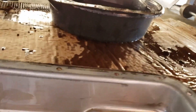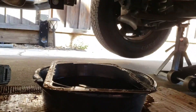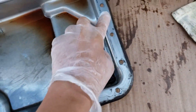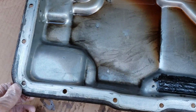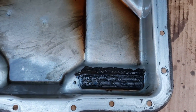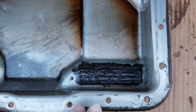I got the pan out and now I just have a bucket drain pan below to catch some drops. That filter we're going to tackle next. As you can see, this is the pan itself — already cleaned the place with this gasket. I don't see too many metal shavings, just a little grime. I'm told that's actually okay. This here is a magnet, and this is the next thing I'm going to be cleaning.